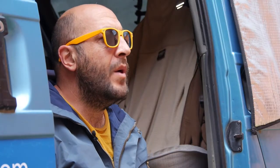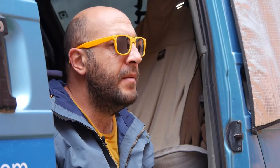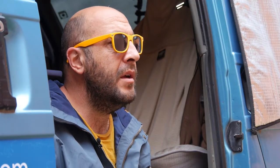If you're thinking of installing one, you will also need a solar panel charge controller. It's a small machine that regulates the voltage from the solar panel and gives exactly 12 volts to the batteries. There are a lot of models on the market. We chose our Western & Co because it gives all the info we need on the display about the status of the solar panel. There's also a third slot where we can plug our computers directly with a simple transformer in a cigarette plug. If you need to charge other electrical equipment, you can also get an inverter. We just upgraded ours from 300 watts to 1 kilowatt as we have more stuff that needs to be charged, and we usually do that while we drive. You simply connect it to the solar panel controller and there you go.